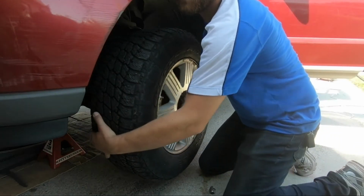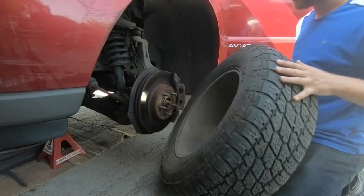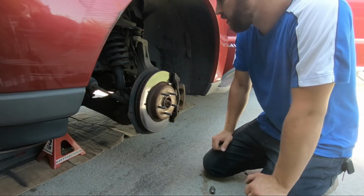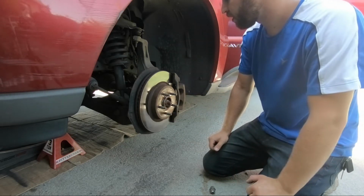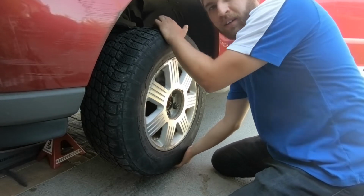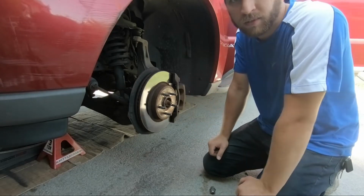Whenever I'm taking a left turn at a high rate of speed, we're hearing this groaning and almost like a grinding sound. Not very loud grinding, but a definite noise. So we went to our local Les Schwab, it's just down the road here, and they got it up in the air and they were able to shake the wheel back and forth, which I should have done just now to check it myself. Moving it up and down here, I can feel just the tiniest of play in there, like a bad bearing. Not as much play on this side, but definite 12 and 6 o'clock play. But they said, yeah, definitely a wheel bearing.